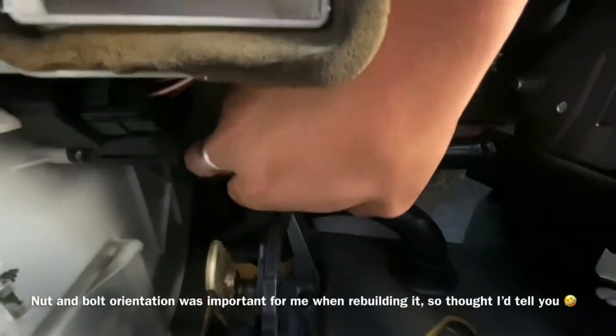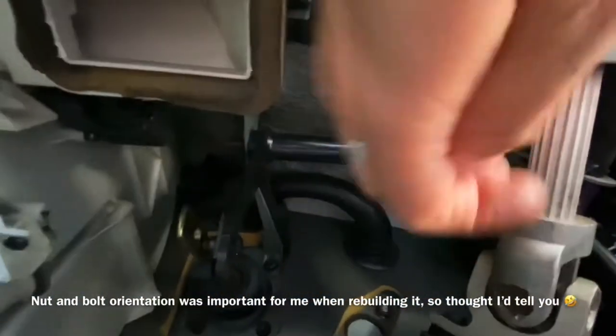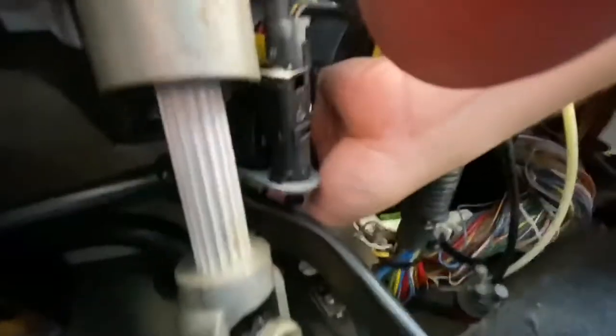We're all disconnected — just got to get the spring clip off here. Pedal loose. End of the bolt off there. The bolt slides in from the outside of the car and the nut is on the centre console side. Pedal's out. Next job is to shift this bracket and compare it to the one from the manual car.